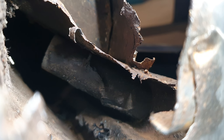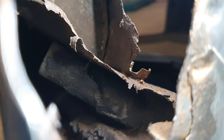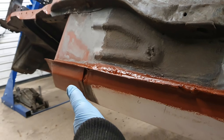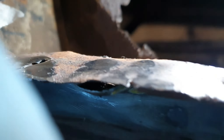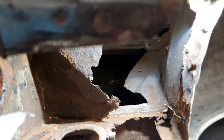There's one at the front just there, because of the sunroof — that tube there is the vent for the sunroof. So when the sunroof fills with water it vents into the sills, and then as you drive along the water comes out of there. But you'll notice that I had to do all of the work where that obviously vents to — just proven that it was an awful design.